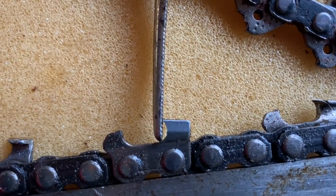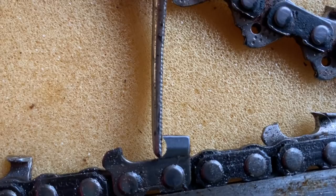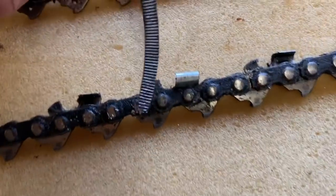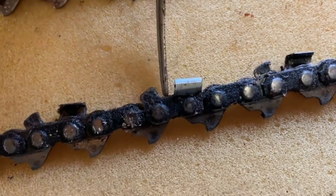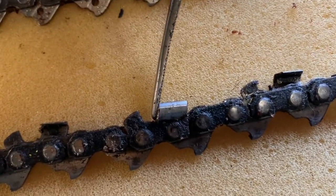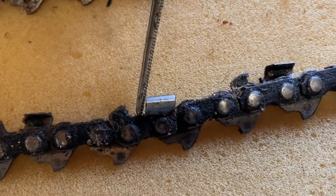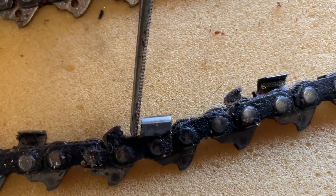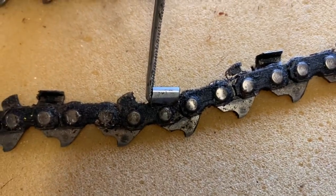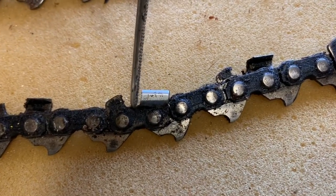Friends, this is what I'm talking about, okay? If the working corner was back further, do you know what I mean? I want all of us to understand what I'm talking about. See, there is no point to grab. And this isn't even terrible. This is round chain, but look, it will cut. It will still cut, but not like we want it to, friends. You see, it's gonna slope back. He's going down a scary road, this fella.